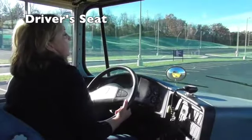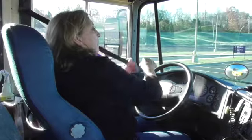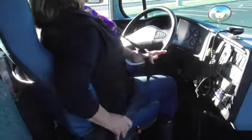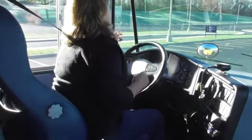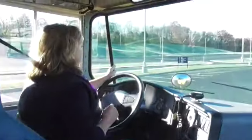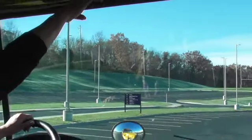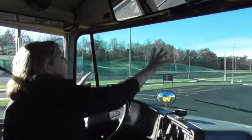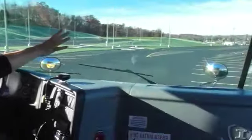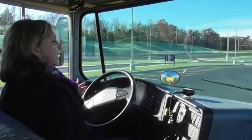As soon as I sit in the driver's seat, I want to make sure that it's securely mounted and not going to fall off its perch during my run. I want to make sure that the seat belt is not frayed or damaged and latches properly. Looking at my windshield from the inside, making sure it's not cracked or damaged and the seal is not dry rotted. My student mirror shows me from the front seat all the way to the back seat and the seal is intact. My mirrors are properly adjusted for me for this test today.